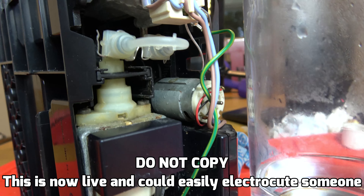After much struggling, I've taken off both sides because if one side is rock hard, the other side is going to be rock hard as well. These are the old ones up top and these are the replacement ones - you can physically see the difference between them. What's happened is these have shrunk and gone hard as the oils have burnt out of them, because it gets incredibly hot in here and they're no longer making a seal. As the pressure builds up it's just spurting straight out rather than being forced through. I'm going to pop these two new ones on and hopefully that will get rid of the leak.